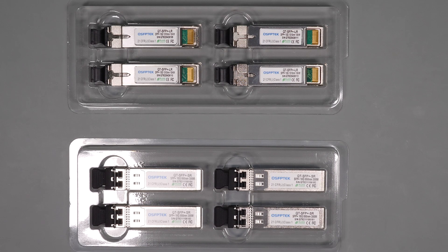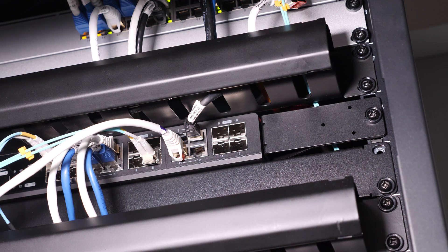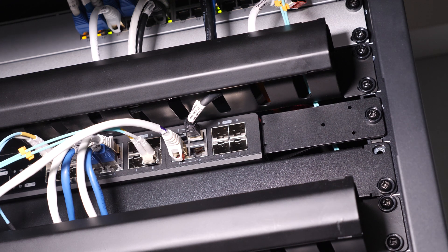At work, I use an SR fiber connection to go from the front of our main building to the rear building with absolutely no issues. In addition, fiber can also be useful for interconnecting devices such as a NAS unit or other device directly to a switch on the same rack. NICs and switches that use SFP Plus connectors can be significantly cheaper as well, making fiber transceivers a good overall value.